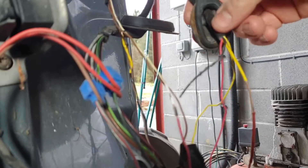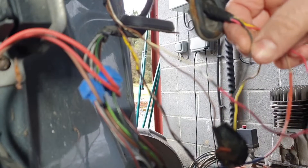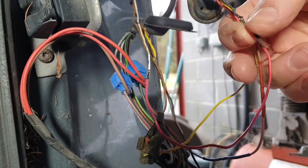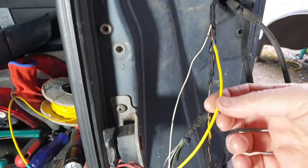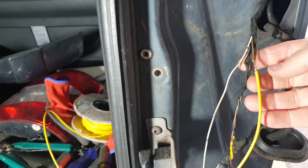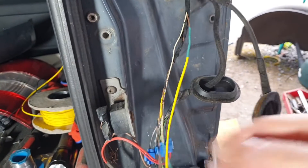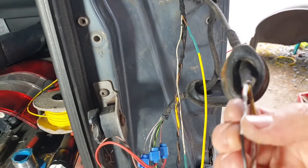That one I'm going to chase back — I might have to remove this grommet and come back up here. I don't really want to do that; I want to stay this side of the grommet if I can. But this wire is so corroded it may make soldering quite hard — it's actually black, so I don't think I'll be able to clean it up to get a decent joint. I kept chasing the wire back because it was so corroded until I could get to some good copper — had to come right back here. I'm running out of space but I managed to find a good bit of copper. I've chopped loads of this out. Even then this one's a little suspect but it's as far as I can go without going the other side of the grommet. It's soldered up alright so it should be fine.